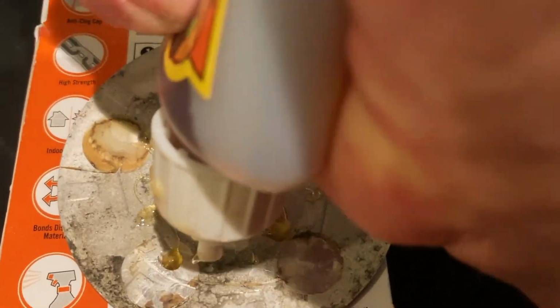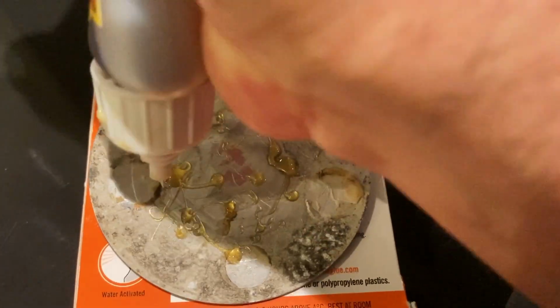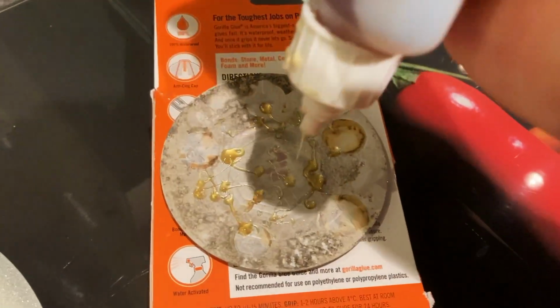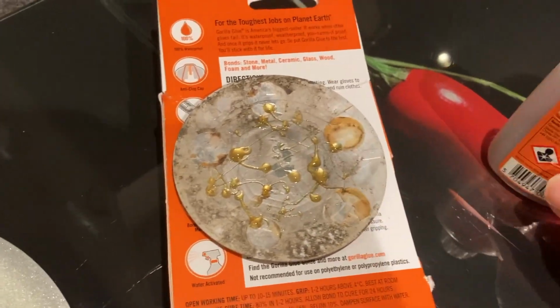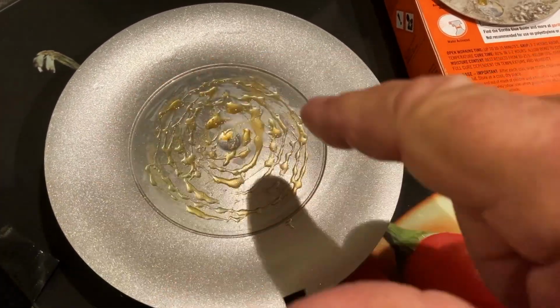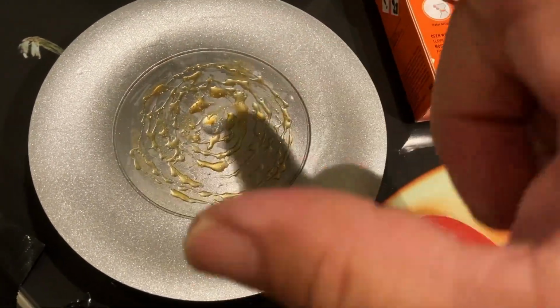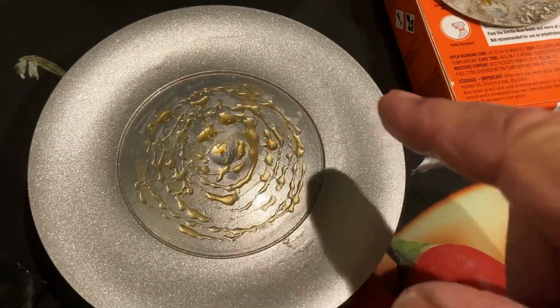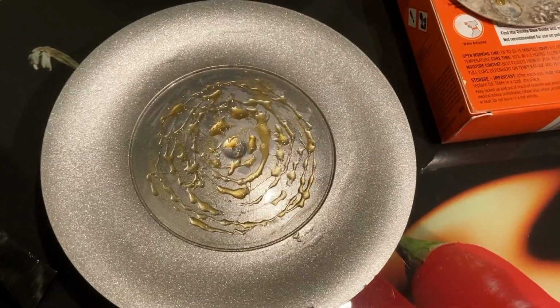And of course, be careful you don't put too much on, because if you put too much on, it'll come out the sides and it'll just be white. In fact, I don't think this was glue, you know. I think this was like little adhesive pads that they put on it. Don't want to get too near the edge. If you press down on this, the glue will just come out of the sides and it'll look awful. What I've also done, actually, I'll just leave that on there, is I've pre-cut some bits of tape ready, so that when I press the badge on top of it, obviously it will rise to the contour of the actual centre cap itself, or the badge will. So this is just to hold it down at the very edge. So what I don't want happening is glue coming out the side, because that will get underneath the tape and it will just look a mess.